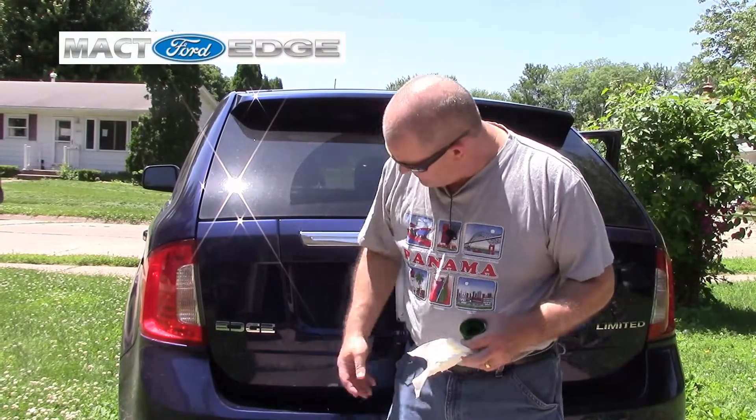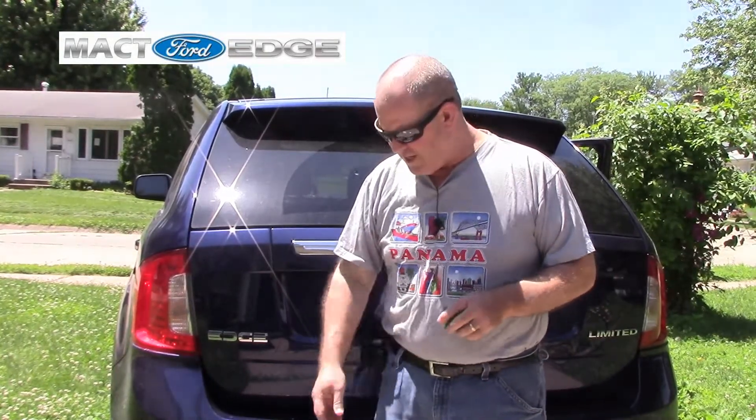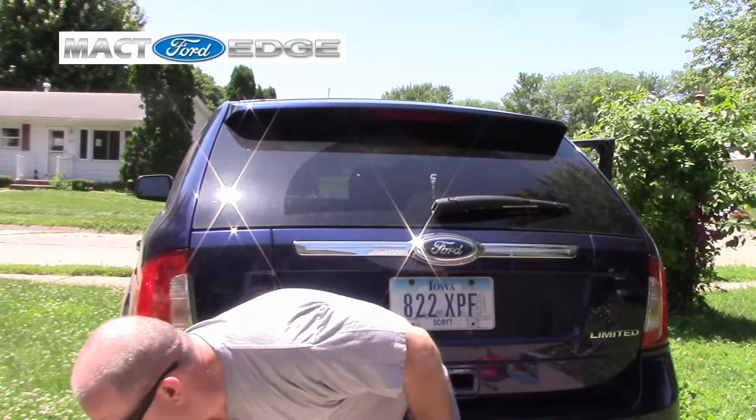Well folks, that's it. No longer advertising for the car dealer. Got rid of the sticker with a hair dryer. We didn't have to use the gasoline, the scraper, the brake fluid — none of that. Hair dryer. Worked pretty simple. Now, keep in mind, if you're going to remove an emblem like this, it takes a little bit more effort, and you've got to make sure you soap it down.